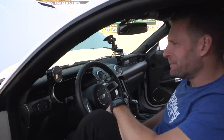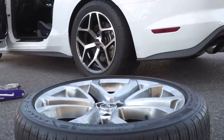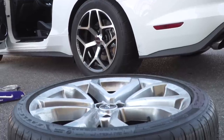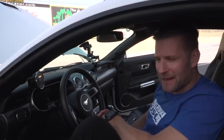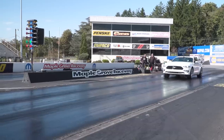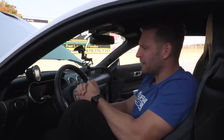The car just really isn't picking up anything with the radials. We were all surprised how well the Goodyears performed — it went 11.90s, so that's awesome. I thought the car might pick up a little in the 60-foot with the radial, but the eighth-mile times are down, mile-per-hour is down. We're hot-lapping this thing so it's not gonna get any faster with the stock tune.